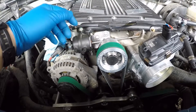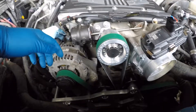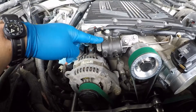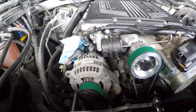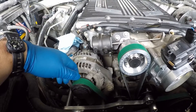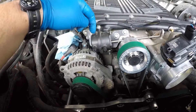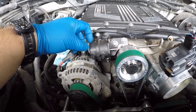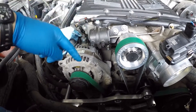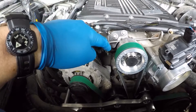I'm sure everybody knows the purpose of this — it's to relieve boost pressure in conditions where it's necessary. What's neat about GM's setup is you have a mechanical side and an electronic side. The mechanical side is just like any other boost or bypass type of system. You have a diaphragm in here with a spring that has tension — that tension keeps the valve normally closed. You have two ports: this port here is for vacuum and this port here is for boost.